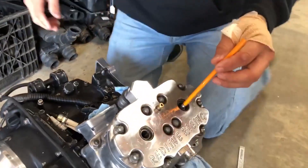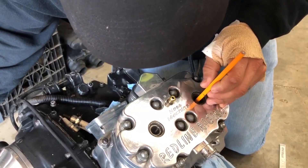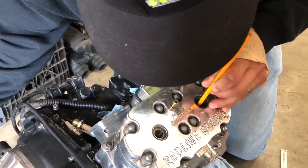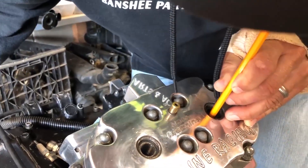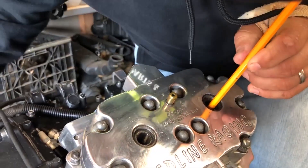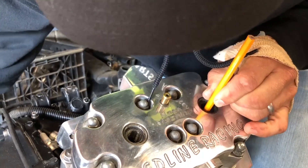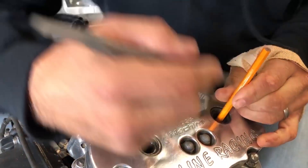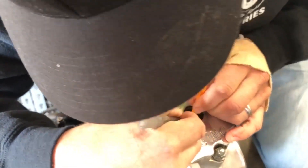Now I have a 4mm stroker motor next to this one here, and I'll show you the difference in the marks. I'll show you how to do this with a kicker — with a kicker it's a little harder because you can't get exactly top dead center. So we're going to roll it over and be real gentle until you get to top dead center. It's up a little higher — about right there. Top dead center is exactly where our other mark is; that's just the way it works. But now bottom dead center is going to be lower. So we come down to bottom dead center, and we're already past our mark. That's about bottom dead center right there because if I go any further it's going to start moving the pencil up. So I'm going to make a mark right here at the spark plug hole.